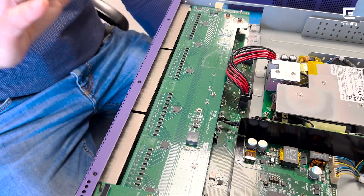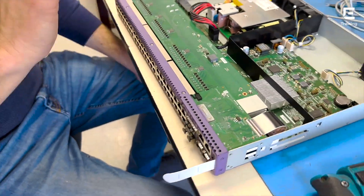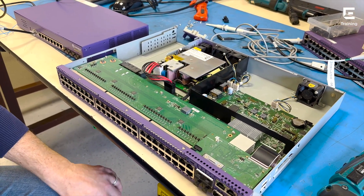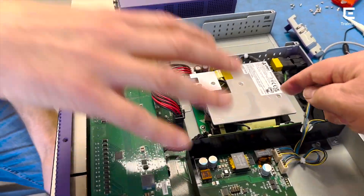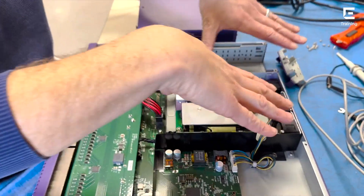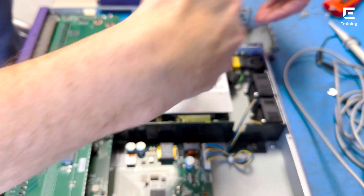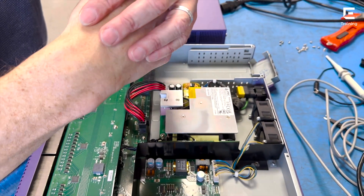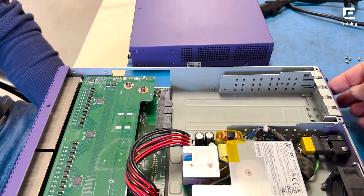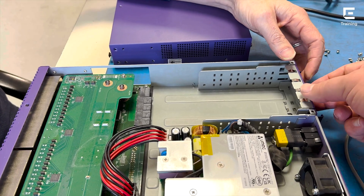You have your 54 volts coming up here through your bus bar, and you can supply all 48 ports at 30 watts on this model. The M model can provide 90 watts on every single port. What changes is the power supply — instead of an open-frame fixed power supply, you have two fixed closed-frame redundant power supplies that slot in and provide more power. There are about three or four different models; the highest is 1,220 watts. You can buy as much power as you need.